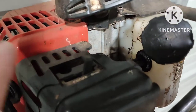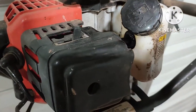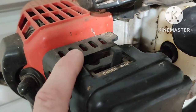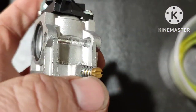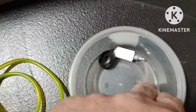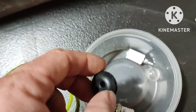So I'm going to replace the carburetor on this. These are like no-name carburetors so I got a replacement — just a cheap eBay replacement — because there's no name on it. You can't really get an OEM one. This one has no adjustments on it at all. But the replacement one in the kit has an adjuster on the top, like a mixture screw adjuster, where the other one doesn't. I'll show you when I pull it off. It also comes with some new fuel line, spark plug, filter, the primer plunger, and also a tank fitting which we're going to replace because the other one is leaking.